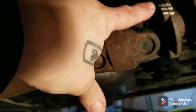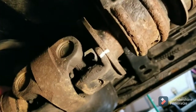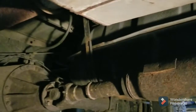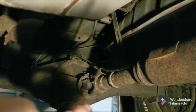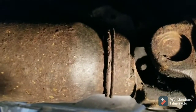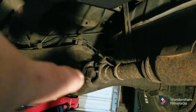I got all those bolts out. Now I labeled where I'm getting ready to take this cardan joint loose from this flange. It's important that your drive line go back together the way you take it out — it's balanced to go together a certain way. Your yoke, the flat part of your yoke, needs to be lined up with the flat part of this end of the driveshaft. One way to tell on a Toyota driveshaft: when they build it, they put all the grease zerks pointing the same way on every end. So if you were in question, just line up your grease zerks in your slip yoke, your U-joint, your cardan joint, and your other U-joint — because when they put them together they line that up. Makes it easy for maintenance.